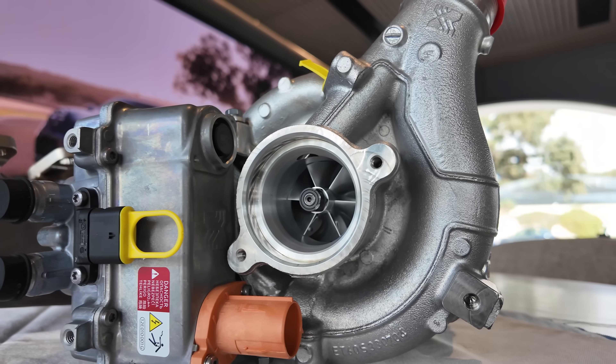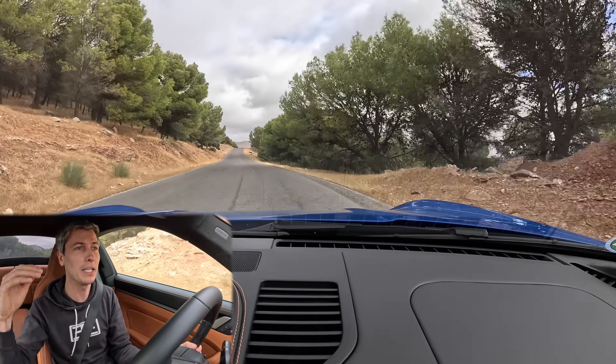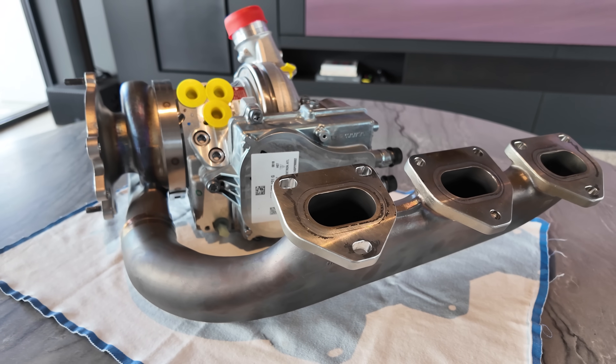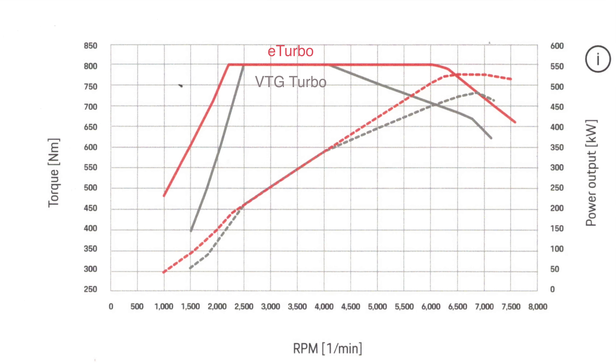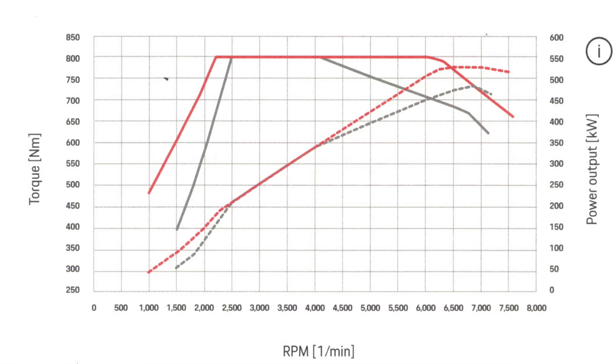When sizing a turbocharger, a large turbocharger gives you lots of power on the top end and high peak power, but your low-end torque curve has to wait for the turbocharger to spool up. Contrarily, a small turbocharger gives boost really early, but it peters out at higher RPM and you can't get quite as much peak power. So now you fit a really large turbo and use the electric motor at low RPM to bring up that torque level. You have a much wider flat area of the torque curve across the entire RPM range. Even the previous generation used variable turbine geometry to widen the torque curve, and even versus that, this is a huge difference.